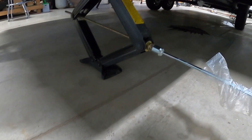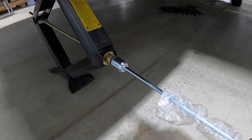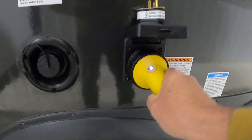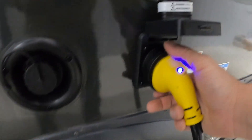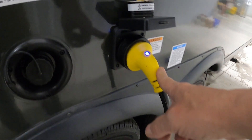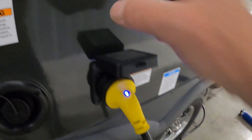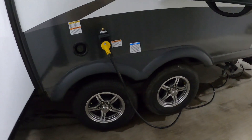Once the hand crank starts to have some resistance and it feels like you might lift the unit, stop. Get all four of them down, then hook up your power and water. The 30-amp cord plugs in on the side — goes in at about 10 o'clock and you turn it to noon, then put that black washer on. That's your 30-amp service. Should you need to plug into a 110, your convenience pack includes a 30-to-15-amp adapter.